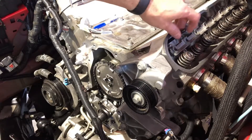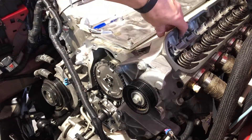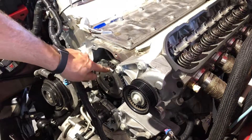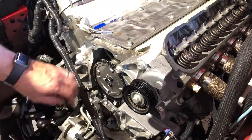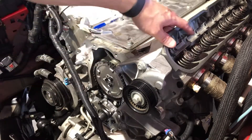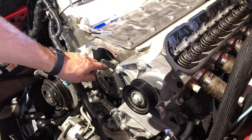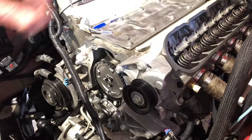When you're done with the intake, you do the same thing with the exhaust. You put the push rod over here, turn it until you find the top, put a mark. Make sure you erase your old one so you don't get them confused, or use a different color. Rotate it until it starts pushing up on your finger and crests — mark straight up and down — then rotate it till it's pointing straight down and you can take your measurement.